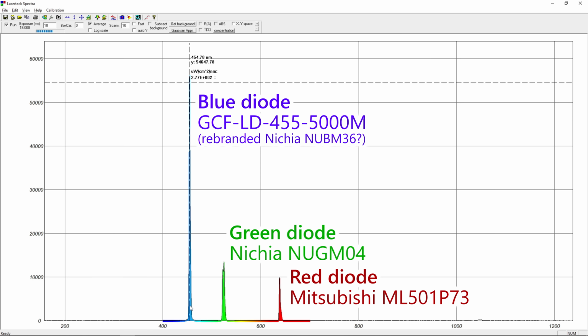Time to test it. I will set the laser power meter to a 503 nanometers calibration, the weighted average of the RGB laser diodes in the show laser. For safety reasons, show lasers will not project a steady beam, which is needed for the laser power meter to heat up when measuring. However, using a secret code, I have access to a pop-up in LaserOS that will give me a steady beam at full power, but only for 5 seconds.